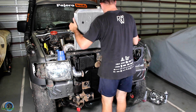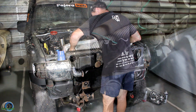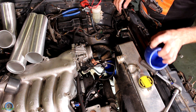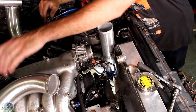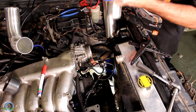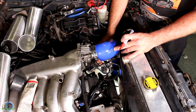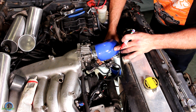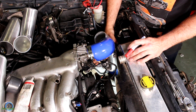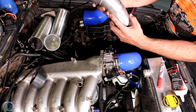Home stretch, let's get this done. I'm sticking the radiator back in to make sure I don't take up the same space as the three inch piping — and looking at it, that was a good idea. To get from A to B, a straight pipe isn't going to cut it. After trying a bunch of pre-made piping, I come to the realization I need to go custom again. I get a pre-made 90 degree bend and a piece of straight pipe to figure out if cutting the 90 degree bend in half to make a 45 degree angle will work — and it would, but it wouldn't be perfect. I need to cut two bends to make it go from A to B. I mark up, cut, reinstall, line up the bottom section to join, mark and chop, then weld it up. All I need now is a straight bit of pipe to make it all come together.